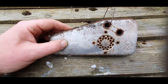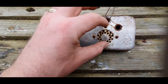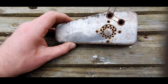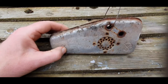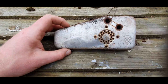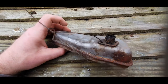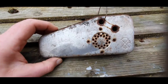You can get heat paint for exhaust systems. Usually these exhausts will have baffles in them, so it's not like a straight-through pipe with fibreglass wadding — you're not going to burn that out, don't worry. It's generally just baffles, so it'll be fine. Just stick it in a bonfire for 10 to 20 minutes. Make sure there's nothing like rubber, plastic, or paper gaskets on the pipe that could burn.